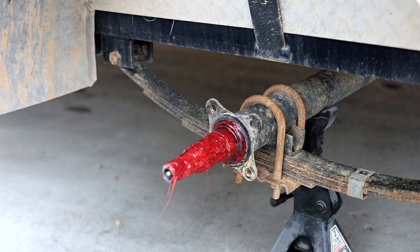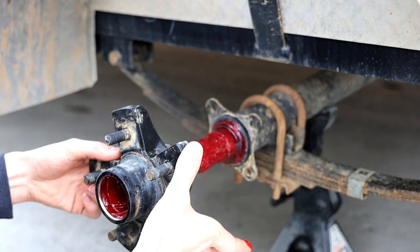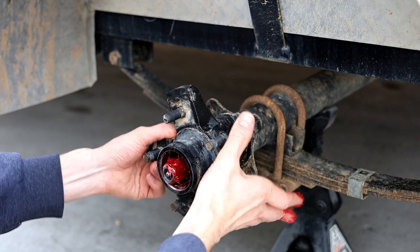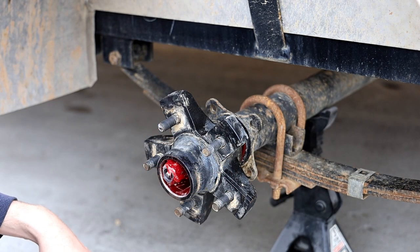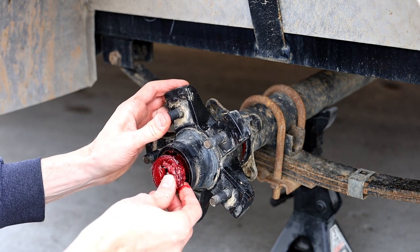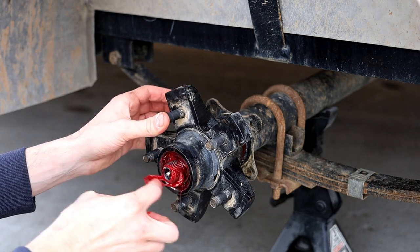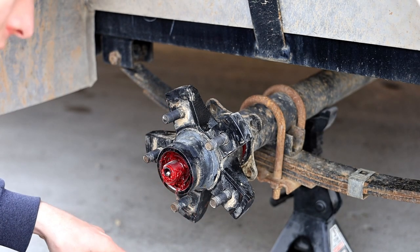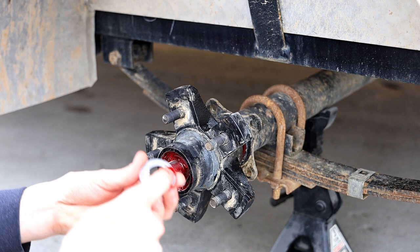All right, so now that that's done, and move our tub aside, and we'll just bring the hub on without striking that lip seal on anything. You'll feel it slide. There it went. All right, and then we'll grab the other bearing that goes into that. Other bearing acquired. So we'll just tip the hub up, slide it in. Give that the old wipe a little bit. Okay, you've got to be careful that bearing doesn't fall out and hit the ground, because if it does, well, you're buying a new one. I'm going to take some grease. I'm going to grease up my little D washer.